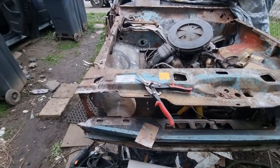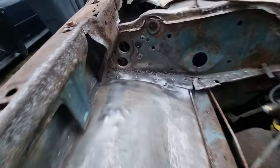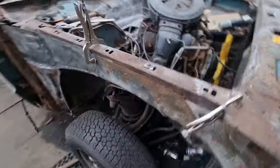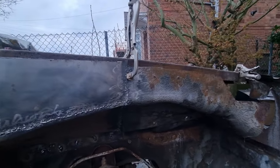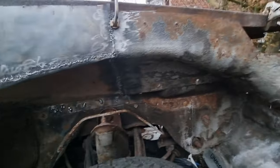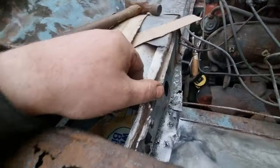Been doing loads of work today. Done — all in there. I've just got to grind my welds down. Done up there, in there is done. The wing fits where it's supposed to fit. The wing top — all sides of those done. Just got to grind my welds down a bit more. The wing top fits perfect — that lines up inside there so that the lip can go in. All inside the arch is done, no holes. I've spot welded it here, just got to grind them down a bit. I put the inner bracket on there for the booster panel.